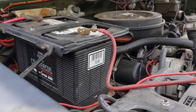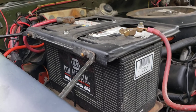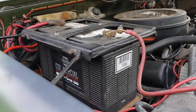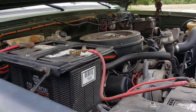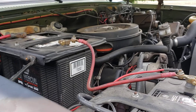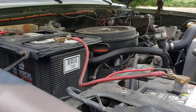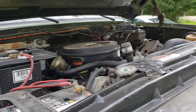When the vehicle is off you should have approximately 24 volts; when it's on you should have 28. And if it's 28 you can just stop right there and say good to go — you don't even need to test the alternators. Mine was 26.8, and that again is an indication but it doesn't actually give me a definitive answer if the alternator was bad.